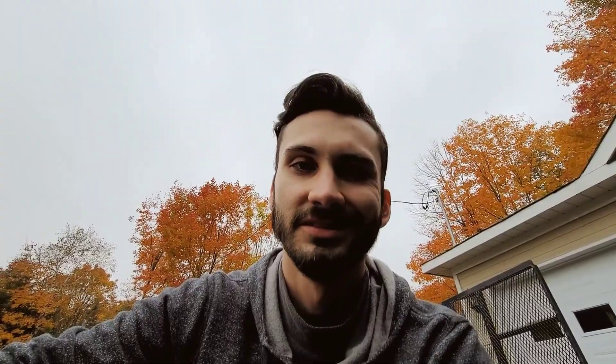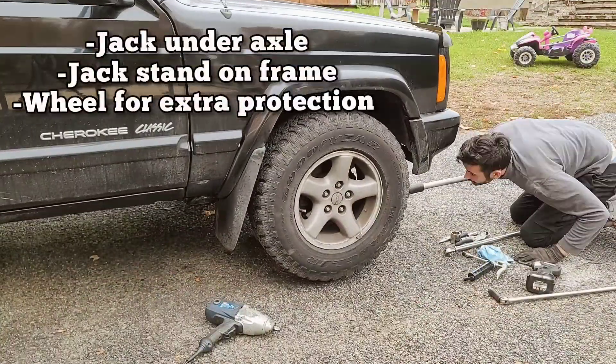We're going to do this upgrade mod — basically super easy to install except getting to it is kind of a pain. We've got to pull everything off to get to the axle, then we slide the axle through this and it goes in place on the outside. That will help keep extra stuff out as well as sealing the axle. It's a bit of an upgrade and it's only about $30 for both, but getting to it is annoying — so let's get on it.